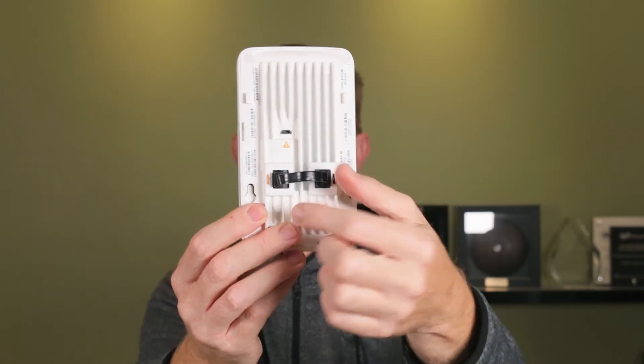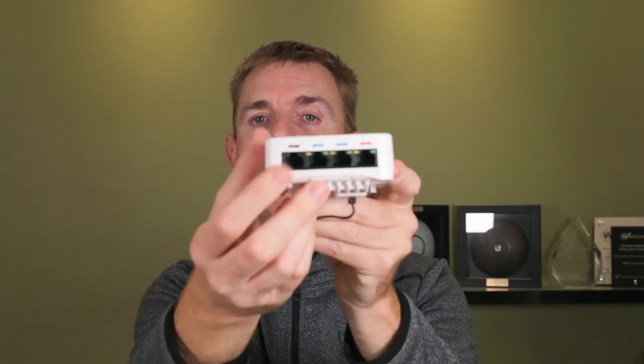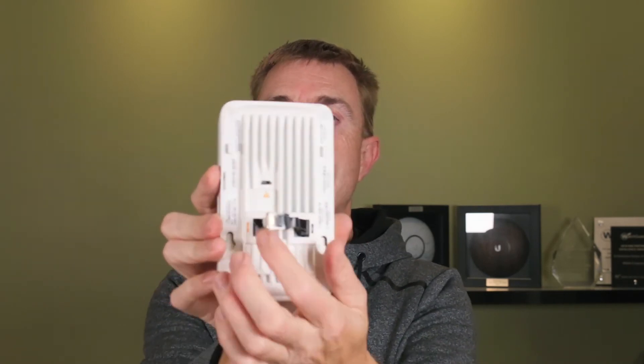Over on the back there is an option — you get a small connector cable here that actually drives the power. It takes the power from port one here and drives it into the back. Why is this interesting and why did I dismantle it? Because you get a faceplate — this will fit over most data points that you may already have in your property, wired back to a comms cabinet or a patch panel or something like that. So you could take this, take the cable out of the wall, snip it, put a normal RJ45 connector on it, mount this plate on the wall with the screws provided, disconnect this cable, and plug that Ethernet cable directly into this port here. This then securely fits into place and now on the wall we have a small access point but also a three-port switch.